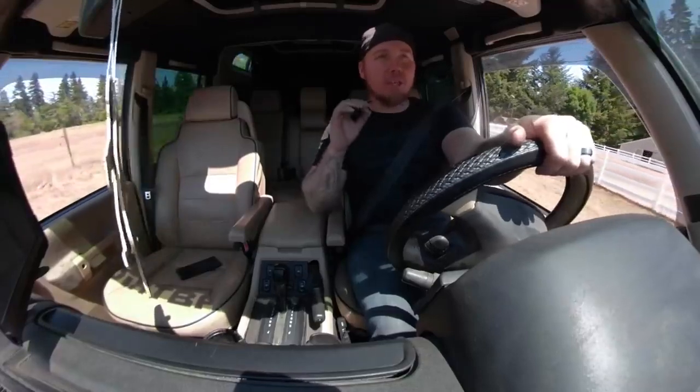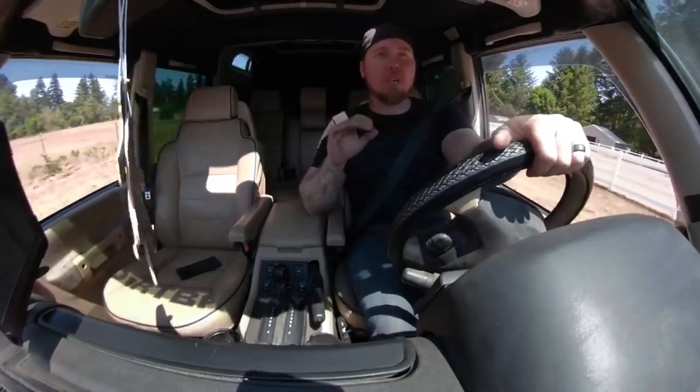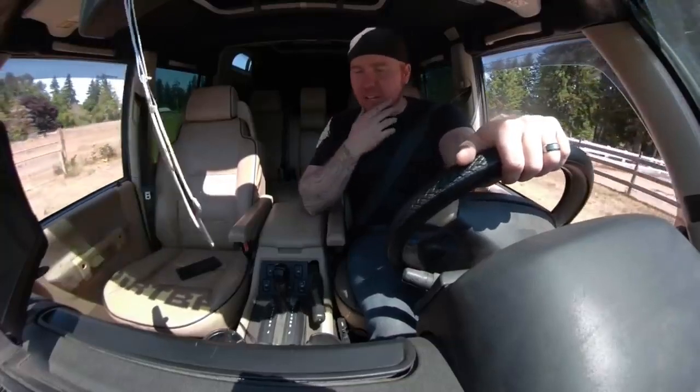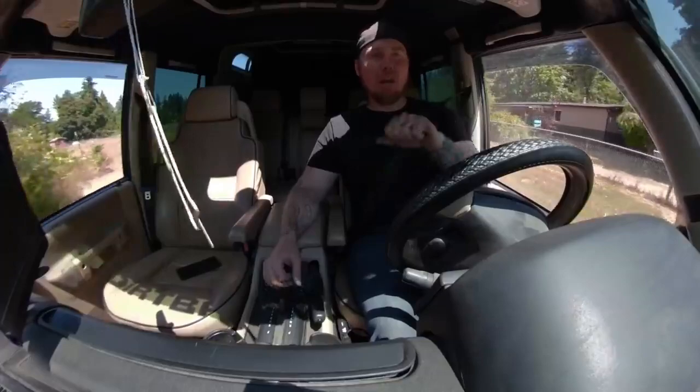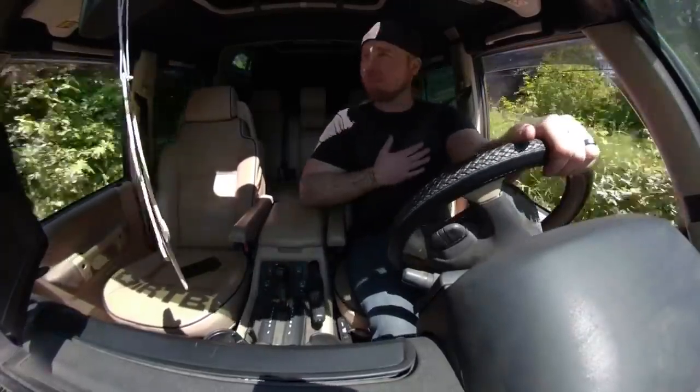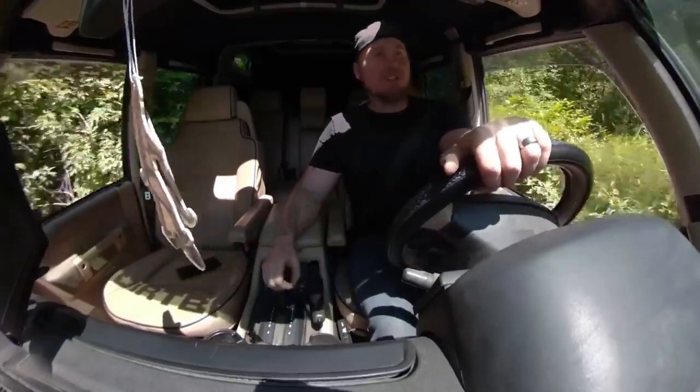I just need to tweak some different things on the pitman arm. So I think I'm gonna cut and change some stuff on the pitman arm, cut and change some stuff on the steering linkage, and hopefully that'll fix what I'm feeling in the wheel. I don't feel any bump steer or anything like that, but it turns more one way than it does the other, so I just need to make some small changes. Oh, excuse me. Other stuff.